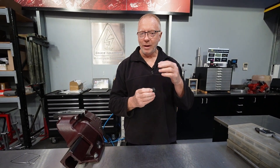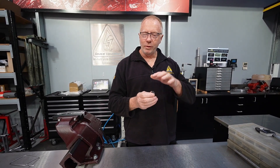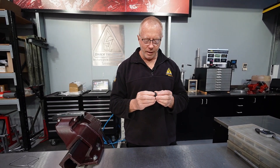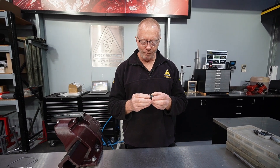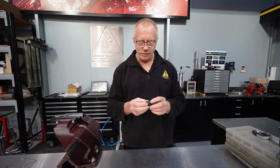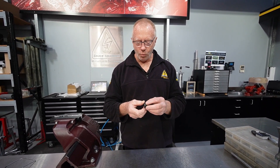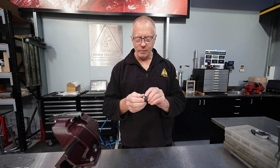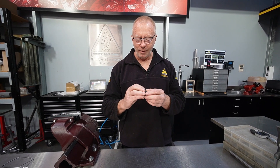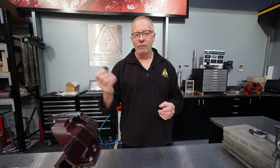The process was that we had that damage on the shock body which needed to be welded. Had we just welded it, everything would have distorted. By installing this plug, we allowed the unit to hold its shape. We still could have damaged the threads with the process, but by having the thread-cutting tool already installed in there, we welded it — you can see the weld — and then after the repair was done we backed it out, which recut the threads and reformed the item.